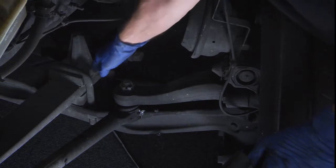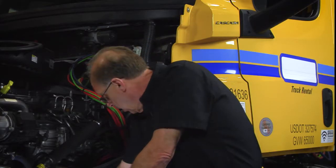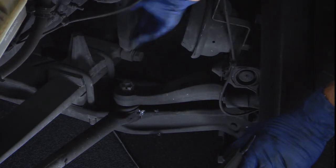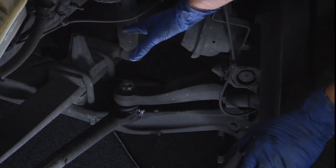We can also look at where the spring is bolted to — we see the U-bolts. When talking about adjusting the caster on this system, you would actually loosen these components and slide a shim in there to get the proper caster. You'll notice there's a slight angle on the axle itself right now. These are the components we'd be looking at when checking suspension for shimmy or other steering issues.